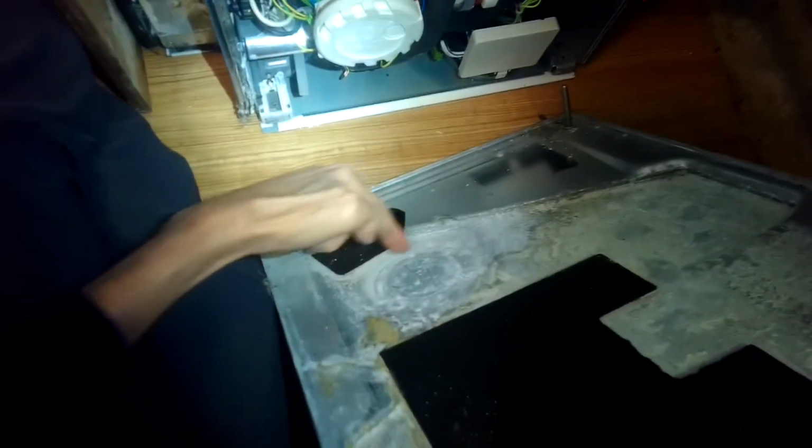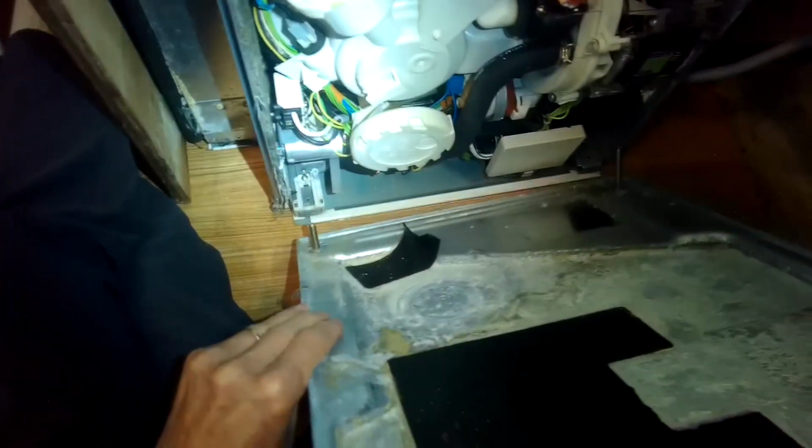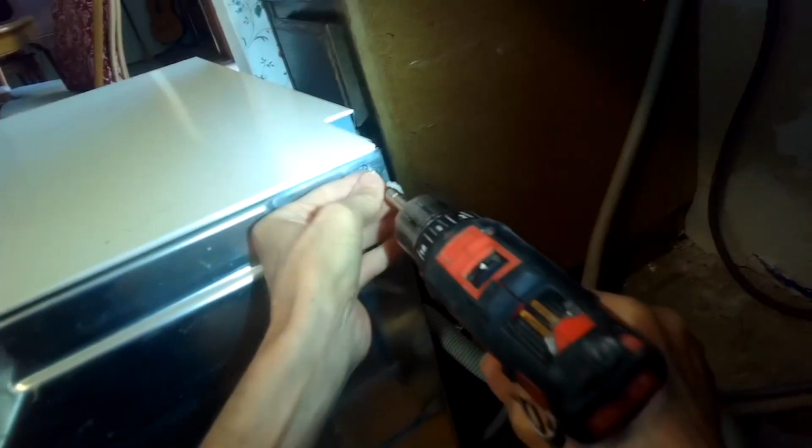Put the drip tray back in. Make sure you get it the right orientation. You could look for this round indentation right here would line up with the float. So we're going to get it over this lip first. Bring it up. Get everything lined up, and we can add those screws back in. Okay, last screw for the drip tray.